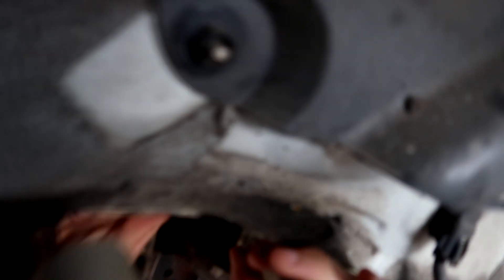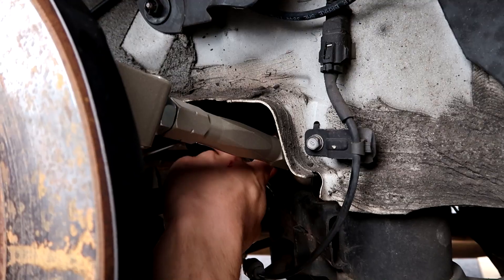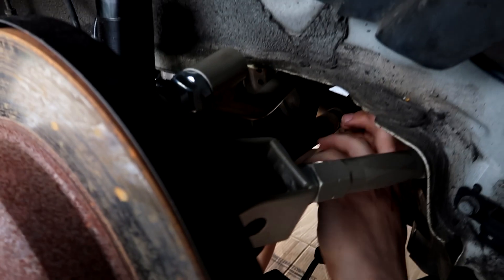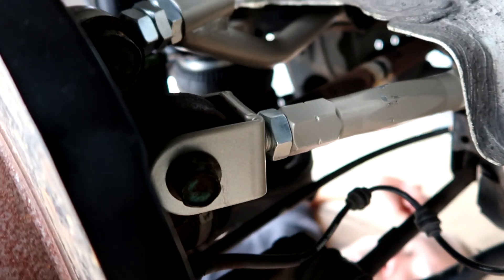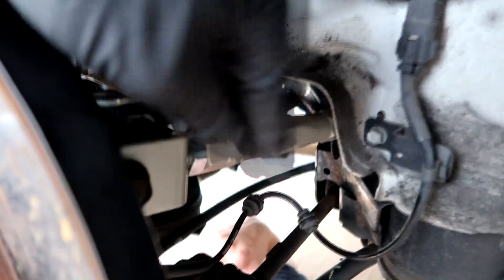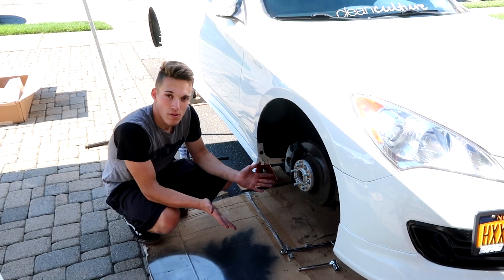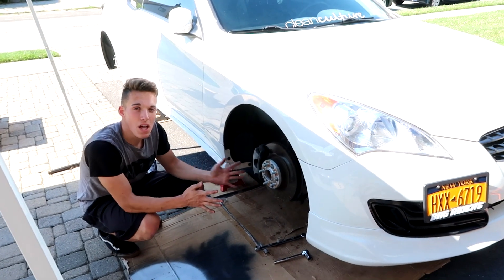It's a little hard to get back there on camera but it's pretty self-explanatory — very similar to the stock toe arm. Once the back bolt is in, you just line up the front. The upper arm is now in with both bolts secured. Both the upper arm and camber arm in the rear are pretty much maxed out — maybe one or two threads showing because the alignment is already screwed up.